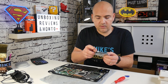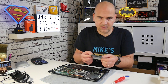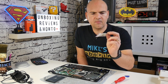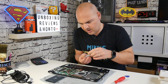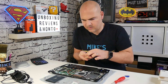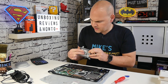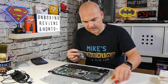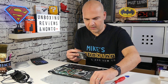Now we need to find some screws to attach the drive to the caddy — luckily these were provided by PC World or Acer and they're in the box. There are four screws inside the packaging. On the side of the drive these should match up with the holes in the drive itself, so using a magnetic screwdriver you can screw the four screws in to hold the drive to the caddy.